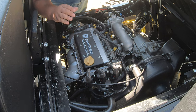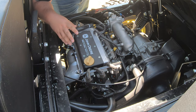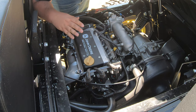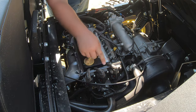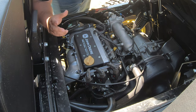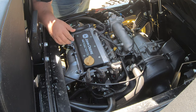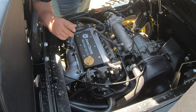Now a little bit on the engine. What you are going to have is a John Deere branded three cylinder engine on top. This is actually going to be a Chery-built engine — just so you know, this is not an actual John Deere design. This is going to be a 52 horsepower engine. It is going to have a CVT belt driven transmission, and it is going to be very easily serviceable. With the bed able to lift up, you've got easy access to the spark plug caps, oil fill, dipstick, and oil filter. That 52 horsepower engine paired with that CVT transmission will give you a top speed of 45 miles per hour.